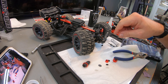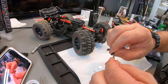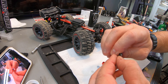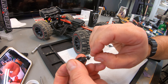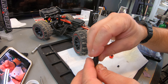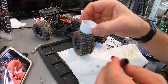I think we're going to be all right — this is just a cheap little RC car. Now put this shock together: there's a little O-ring, and the piston doesn't look like it has an up or a down. Got the tiny little pin. Working on this thing, you've got to have good eyes. Drop the piston down into the hole, a little double stack, pull that through, take the washer thingamajig, and then take the bottom compression cap and screw that back in place nice and tight. Then we can take the shock fluid and refill.